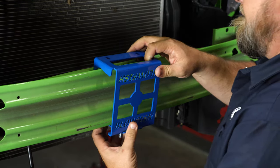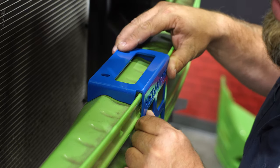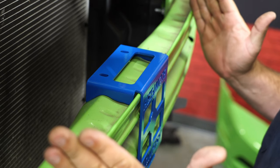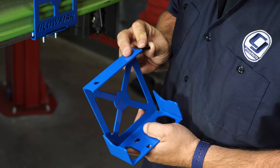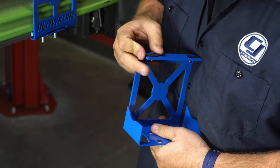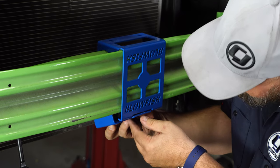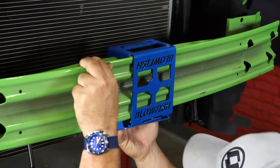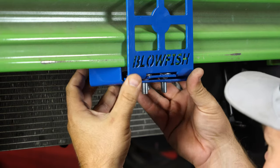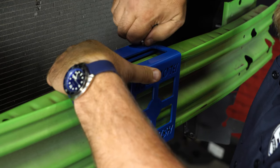Put the bracket over and center it. As far as centering it, there are dimples here — we're just going to center it right in the middle of those dimples. But you can offset it left or right; if you wanted to have it further to the passenger side or further to the driver's side, anywhere in this window you can mount it. Now we're going to grab the rear bracket and grab the clips. We're going to go on this side with the barrels facing towards the center, line up over the holes, then install this. Put it over the bolts at the bottom and kind of work it up into place, then use the supplied hardware and thread that into the clips we just installed.